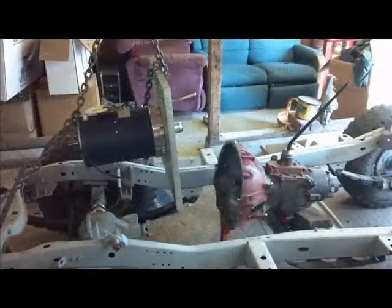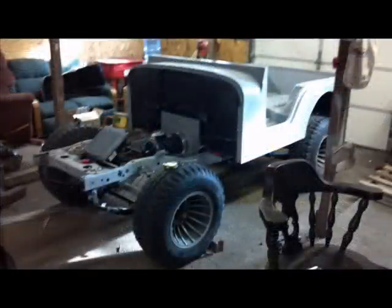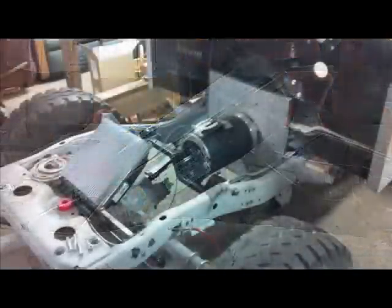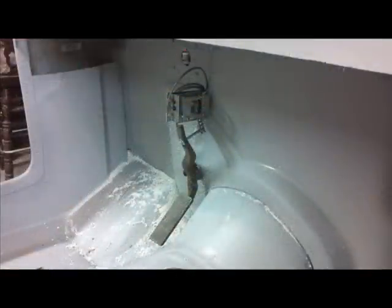With the motor purchased, we then bought an aluminum plate and machined it in order for the motor to mate with the transmission. With this done, we then welded up a frame, dropped the fiberglass body on, and welded up a mount for the AC to DC converter. Additionally, we bought a heatsink for the AC to DC converter to keep it cool during operation.